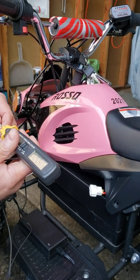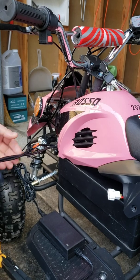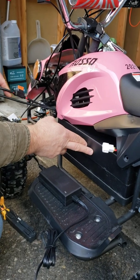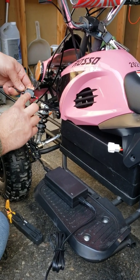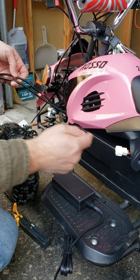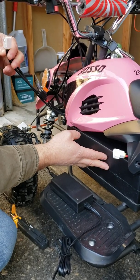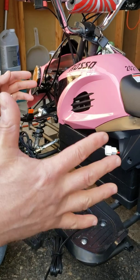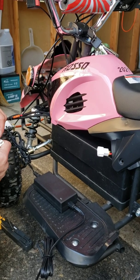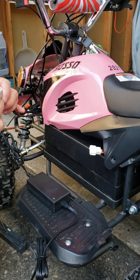If you're testing your batteries and you don't have any voltage coming out — like zero — that means one of the main wires is loose inside the battery pack, or maybe it's broken. Maybe this fuse holder looks okay from the outside but it's not passing power. So you will have to test those wires for continuity, including all the wires inside the battery pack, because you're going to have three separate batteries connected with little wires. Maybe you'll find corrosion on the battery terminals or a broken wire, so you will have to reinstall them and then you'll have voltage coming out.